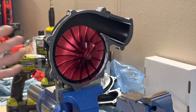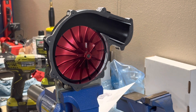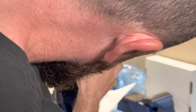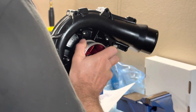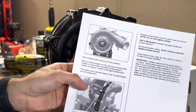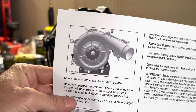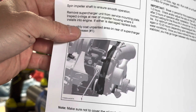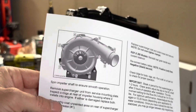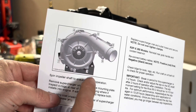The gasket maker is on and the spacers are set. We're going to take our front cover and place it over, making sure everything lines up and seats in correctly. We've got a torque sequence to follow — everything is to be done to 96 inch-pounds, but I'm just going to round up to 100 inch-pounds. It's hardly any extra torque and it makes it way easier. The sequence goes: one, two, three, four, five, six, seven, eight, nine.